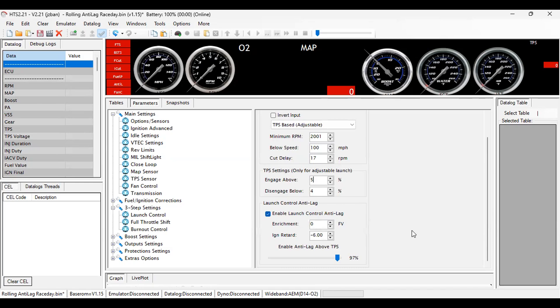Pretty much when I press the button and I'm giving any throttle it starts engaging, but I have it so over 97% throttle is when it's actually on anti-lag building boost. That's so when I stab the pedal all the way down it starts building boost. The reason I set it so high is because at 50% it was doing a really slow limiter — instead of quick pops it was just bang bang. Setting it to 97% fixed that.